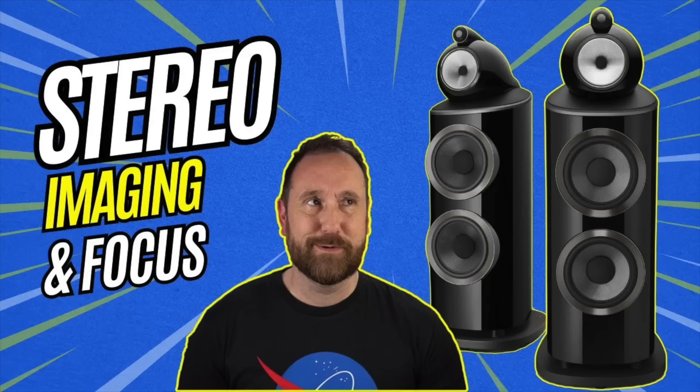On the flip side, going to the side of the speaker it's actually pretty wide — about plus or minus 60 degrees in overall radiation pattern. I like that; it's kind of the sweet spot for me, because it's wide enough to include the room and its reflections, giving a little bit more sense of ambiance, but not so wide that it sounds diffuse. In a smaller room, wider radiation can introduce more diffusivity to soundstage focus and imaging. I did a video about that a few weeks ago if you want more details.